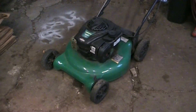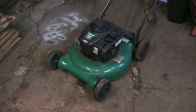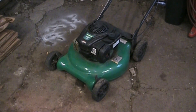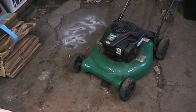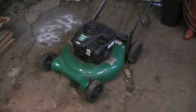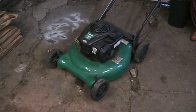Hey guys, welcome back to another video. Today we're going to get this weed eater push mower running again. Customer's job - he says he can't get it started. It sat for a couple of years outside, got some old gas in it. We're going to dump the old gas out, change the oil, pull the carb down and have a look inside. Some fresh gas in it and go from there. This might be a little bit of an informative one.